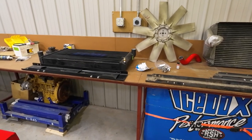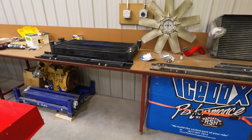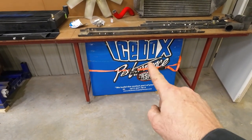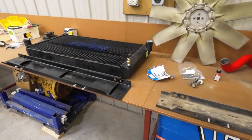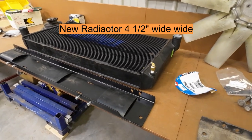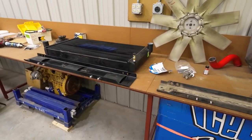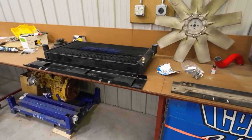I sometimes put up to four horses in the trailer, so up to probably about 10,000 pounds is what I'm pulling. That's when it shows up the faults in your coolant system. The radiator I put in two years ago was a narrower radiator — I paid $2,600 for it. But this new radiator, which is a wider core, was $5,600. If you look at the big picture, what would it cost being broken down a thousand miles away and having the unit towed back? So much as I hated to do it, I had to get the best radiator I could.